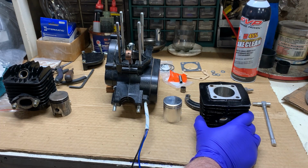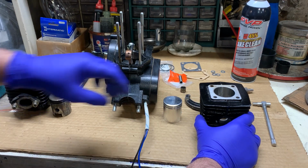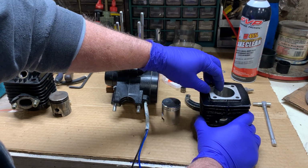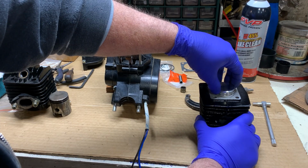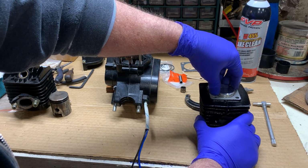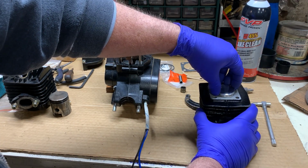during break-in, if it's just a smidgen off, and I won't kick out any numbers because I don't have any specs on what the wear is before the ring seat. And by the ring seating, I mean in the very beginning during your break-in period, none of the parts are matching. The rings haven't completely seated and sealed in the hole, etc. So that's why during your break-in period, you don't want to hot dog your bike too much and race it, because you'd like these parts to casually meet, casually wear in. When the rings seat, they make a perfect circle. That gives you your 100% compression.